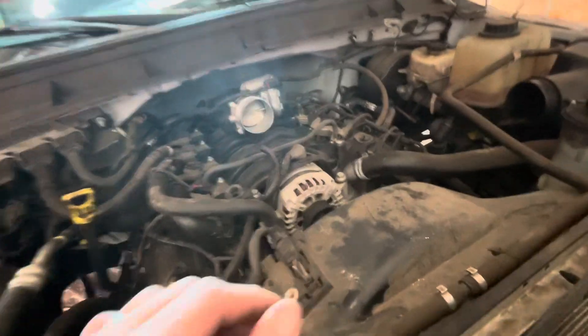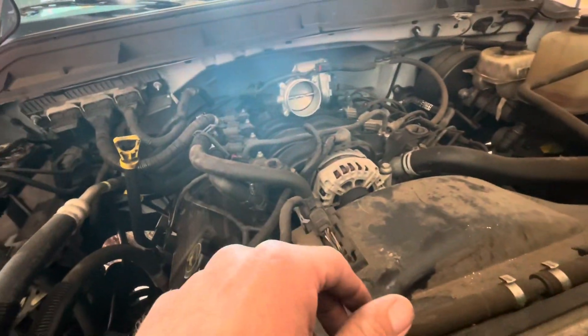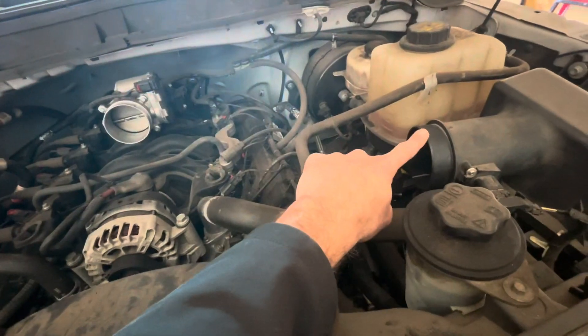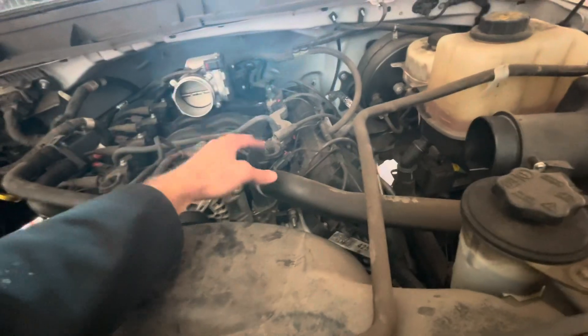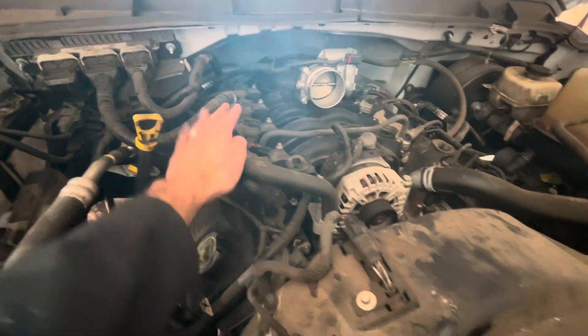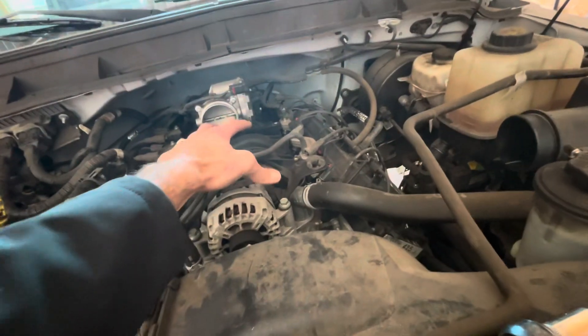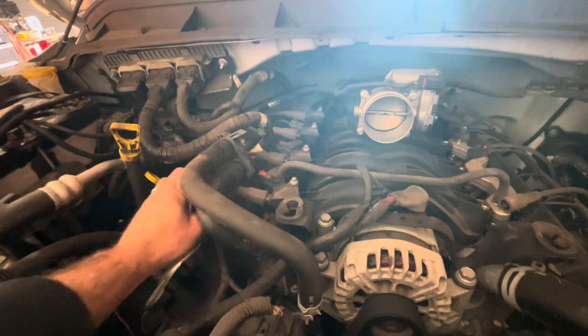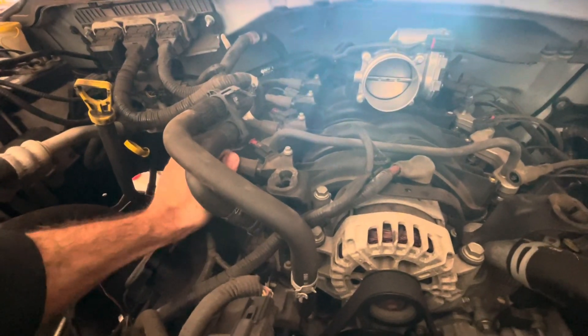If you're going to do a service on one of these trucks, it's 16 spark plugs and you need to service the coils. If you have about 50,000 miles on it, you don't have to do spark plugs — just pull the coils and service them. You need an eight millimeter wrench or ratchet. Pull the connection here, the connection on your throttle body — this whole intake pulls back and comes off. The coils are held on with an eight millimeter. Push your yellow or red tab back, push down, release it, and you can twist these lightly and pull them off.